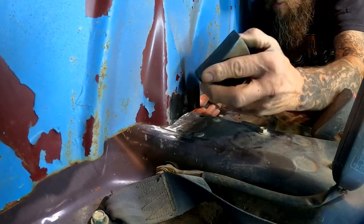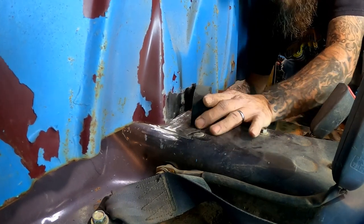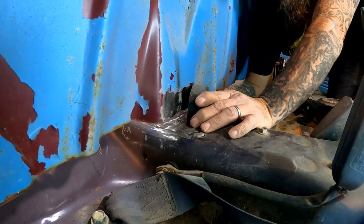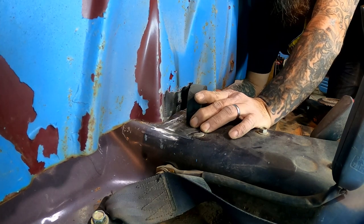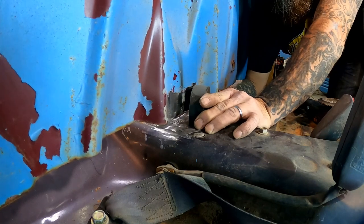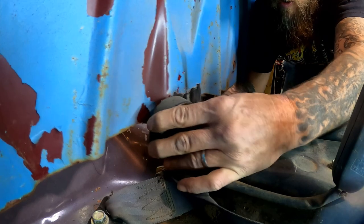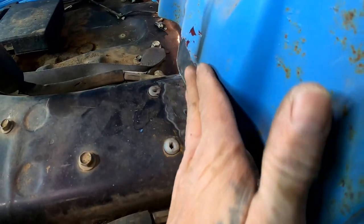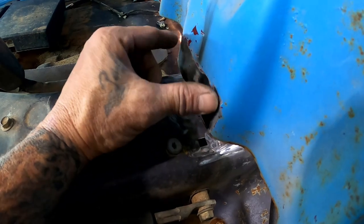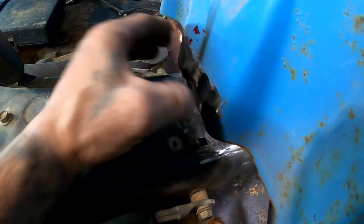Shouldn't take much more of that, I think we'll have it. Kind of hold our dolly over to the side just a bit, see if we can't get that to come out just a little more in the middle. Look at that — that's what we need. Now it's a lot flatter; when we lay our piece up there it'll lay on there nice and flat, won't have a weird little gap in between it or anything like that.